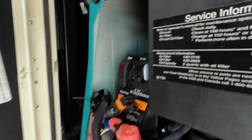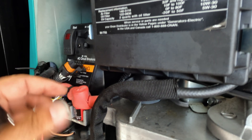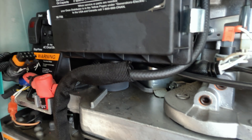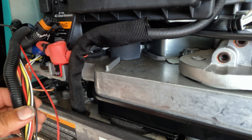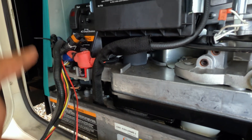I'm back out here by the generator and I've unplugged the harness. This is the remote harness and this is what goes to the generator — these are the pins. What we're going to do is tap into the wires. I already pre-ran two wires that are needed. These are the two wires I'm going to splice into the factory harness to get the gen start-stop working. Every coach is going to be different, but basically these wires run underneath the length of the coach back to the bay where the gen start-stop box is.